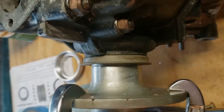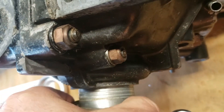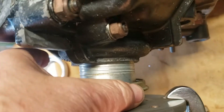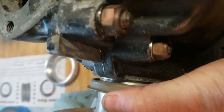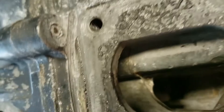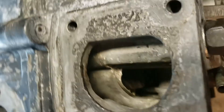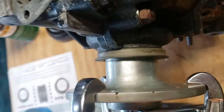Now I wanted to show you how that prop hub seal works. Here you can see how the seal would be attached if you're doing one of these do-it-yourself VW builds — they would slide that to the front of the case and pack in a bunch of JB Weld around it to lock it in place. Problem is, if you ever have to do maintenance on your engine and take it apart, you've got to break out all that JB Weld. It's a mess.